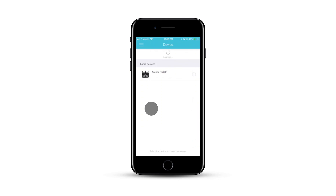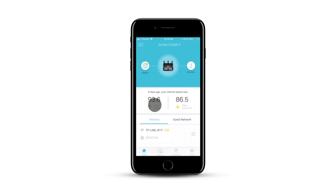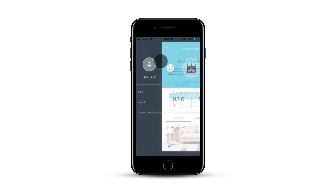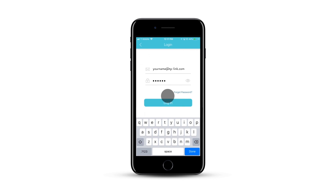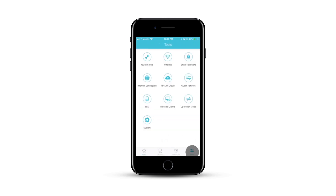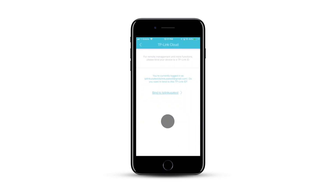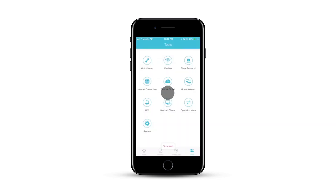Click on your router to log in. Go ahead and click on Later. In the upper left-hand corner, click on the three bars. Click on where it says TP-Link ID, and either log in or sign up. From here, click on Tools, then click on TP-Link Cloud, then click on Bound TP-Link IDs, and in the center click on Bind To. You should see a message at the bottom: Success.